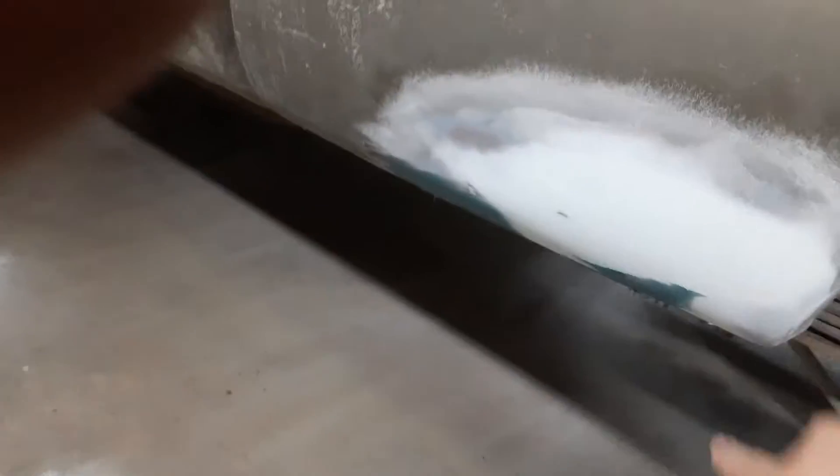We ground it clean to bare metal and welded a patch on to drill a new hole to re-attach the bed. Then some Dura Glass and Bondo and that's it. I just threw a little Dura Glass down here because I had some extra, filling in imperfections. I'll sand that out with the DA and 80-grit and prime it — won't even use any finer sandpaper, just because it's getting a real cheapo job, if you want to call it that.